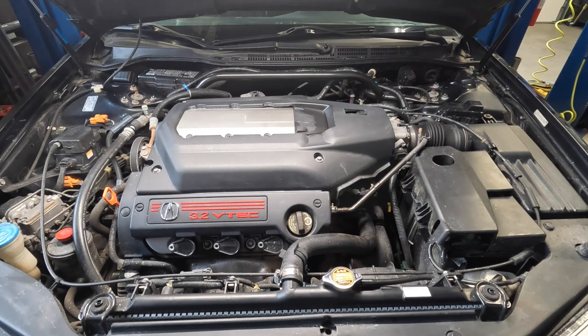In this scenario, I'm assuming this car had a 50/50 mix to begin with, had a leak, the customer poured water in, and they never rectified it afterwards — they completely forgot to flush the coolant. So let's say the mixture went up to about 70% water and 30% coolant. In the climate we have here in Illinois, that's not a good thing — it's more susceptible to rusting and freezing over.